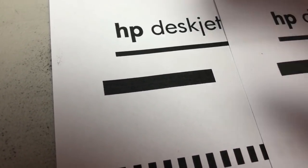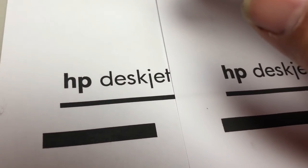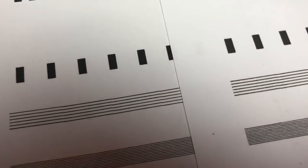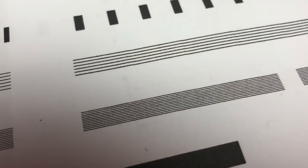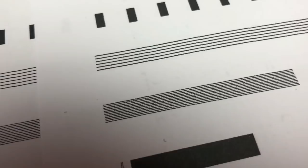So you have to contact us and send out some paper samples. And we have anti-abrasion fast dry pigment ink that you can use. And the other thing is, you can see, if it only lays on the top, the line seems to be separate. Okay, but here in the dye ink, the line is kind of spread out a little bit, because when the dye ink penetrates, it not only penetrates vertically, it also penetrates horizontally. That's why you have this.